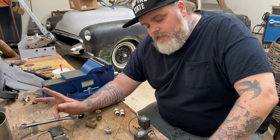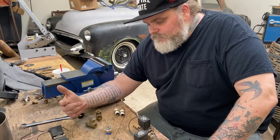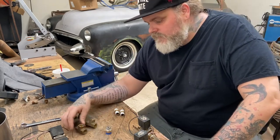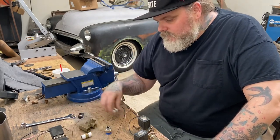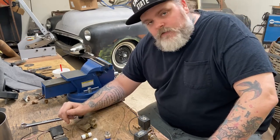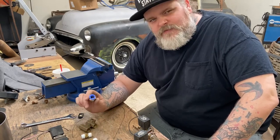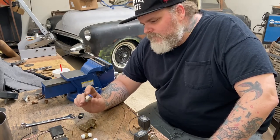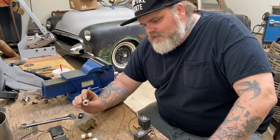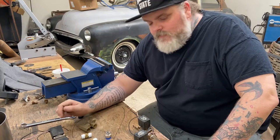Two valves per bag — one up, one down. Today I'm just gonna show you how I do that plumbing. I've got some simple fittings here, some airline, and some push lock airline fittings for the air going in and out. It's real simple to use. Back in the day this stuff all sucked, but now it's much better. As long as you're not running over 200 PSI, these push lock fittings seem to work pretty good and don't leak.